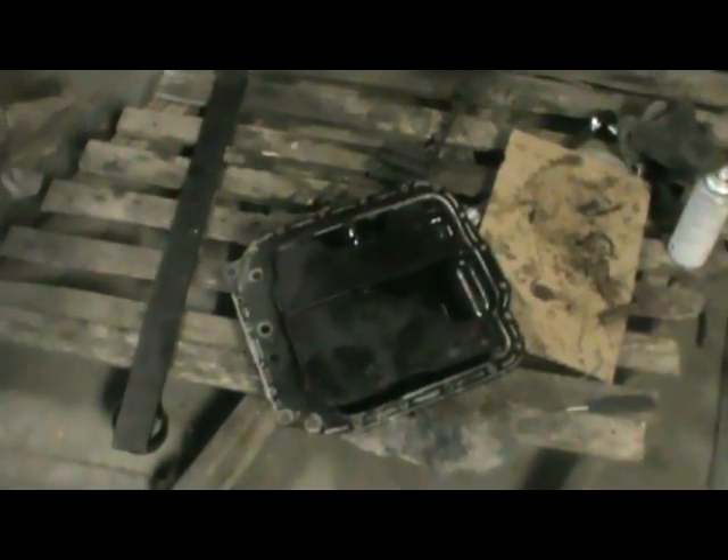Picking up where I left off in the last video. I got my oil pan, the flange is all clean. I went around with the wire wheel and rinsed it all out with some Varsol, gave it a new paint job so it's all nice and shiny. I cleaned up the flange all the way around and I'm going to be using that grey silicone, running a thicker bead on the inside edge and smoothing it out over the outer part, then toss the oil pan on.